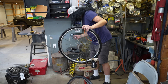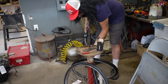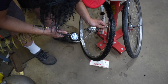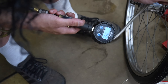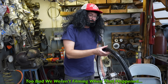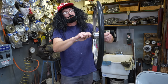That's on. So we've got this handy dandy air gauge built in — a fan actually sent us this, Dennis was his name. You're just sticking it on the valve stem here, turn it on, and it tells you how much is in there, which is nice. We're going to go about 40 to 45 PSI. Like I said, I aired it up to 70 or 75 pounds and that thing blew up like a bomb. Let's check and see how true it is. I don't have the proper tools yet — I'm still kind of building up my tools for my bike stuff since I just got into this hobby. I just want to make sure the tire is not too uneven and the rim looks good.